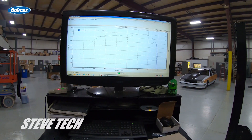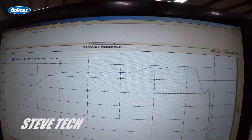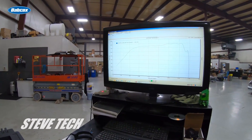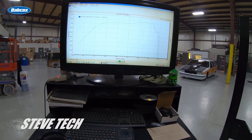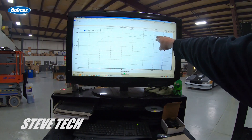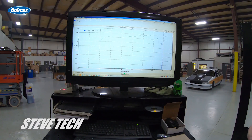Take a look here — we're at 795. Gave it a little bit more boost right up in that area. I'll download the data log and take a look at it. I put 5 psi on the gate, starting at 6000 RPM, putting pressure on the gate, which is probably right up there in that range where it started putting boost into it. That looks pretty good, pretty happy with this. And those are actually 66 millimeter Borg Warner turbos. We'll look at the data log and then go back and make a full pull.